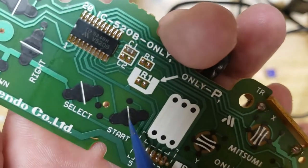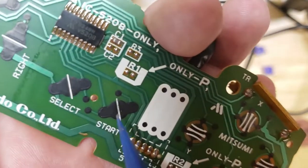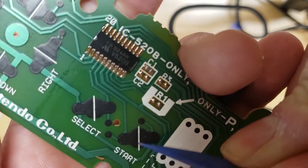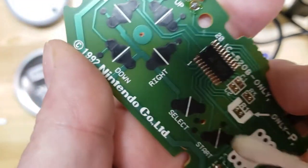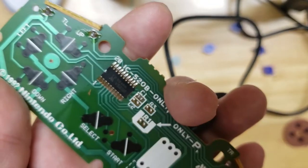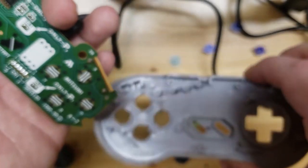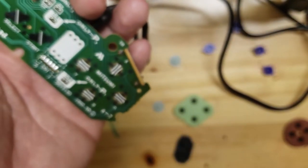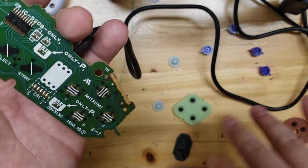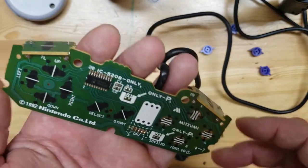If you look here, this side is clean - here, this side is not clean. I've already scraped a little bit and I'm gonna give it more to make a good contact in between. That's probably why this one was not working. So a little clean scrape across here, another clean action here - this whole area was pretty disgusting and that's clearly what was gonna cause the issue. I'm gonna let this dry. I've got this looking better - didn't do 100% but I've got about 10 of these controllers so I'm not too concerned.